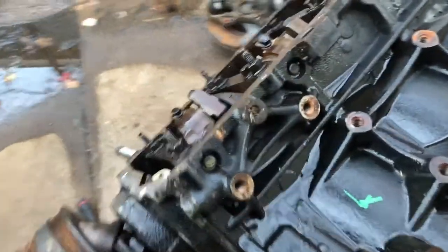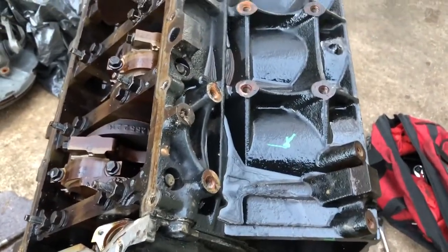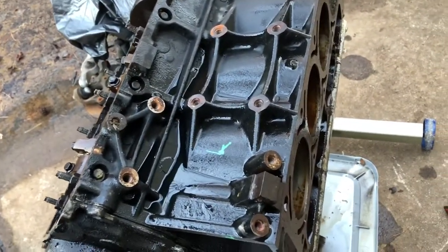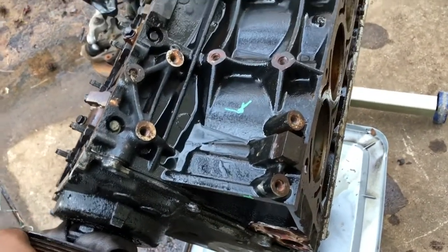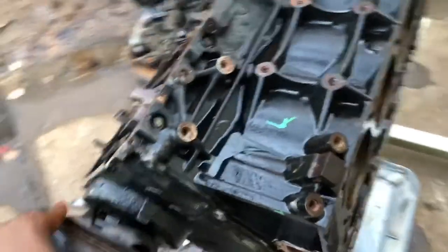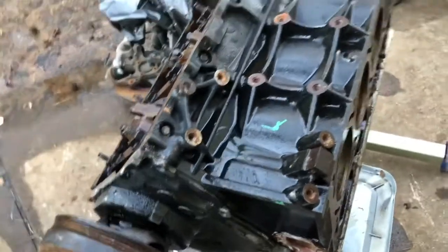So basically, to make a lot of power, all you really have to do is put a cam in here, cam and springs. But some people also do lifters and stuff like that, like LS7 lifters. I've heard of people doing an LS6 cam, 243, that wasn't this motor. Port the heads, though this motor came with 862 heads. And you can probably make up to like 400 horsepower with just that combination.